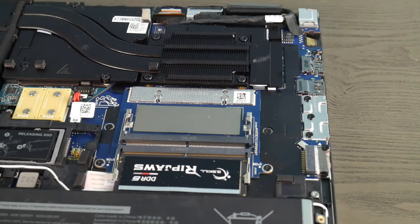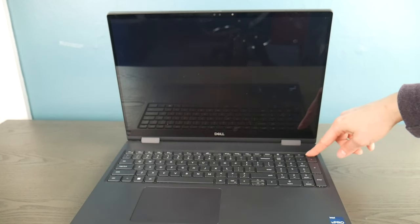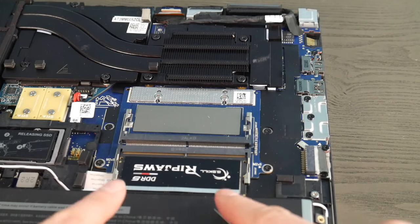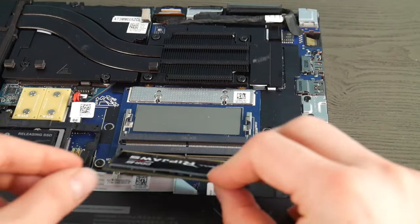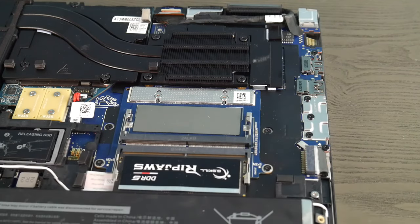Then I'm going to try starting my computer. If the computer starts and the screen turns on with no problem, then I know there is an issue with that removed RAM stick and it needs to be replaced. I'll show you at the end how to buy a replacement. But if it still has a black screen, the next step is to swap out the RAM stick for the other one, because it could be that just one stick has failed. By the process of elimination I test the other one too — they tend to fail one at a time.